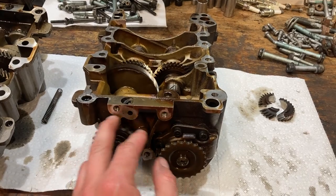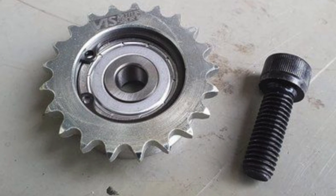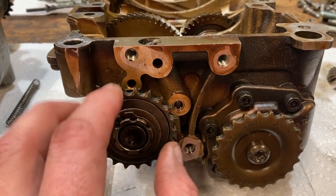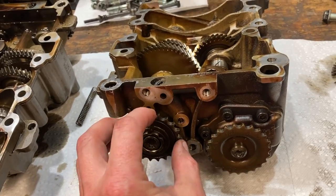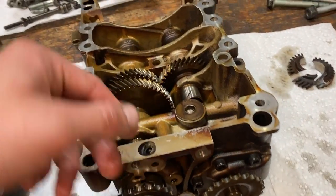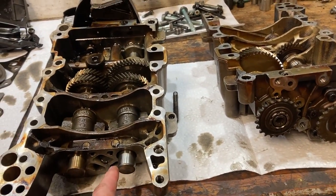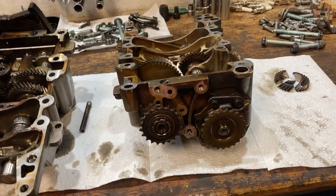Your second option is a freewheel option. What Wassa offers is a freewheel sprocket — you leave this whole pump assembly bolted to the underside of your engine and just swap out the sprocket. It disconnects the shaft from the sprocket right at that point, so as the chain comes around it continues to rotate the sprocket but the shaft remains inactive, making the rest of it inactive. That's about $187 to $250 and fairly easy to install. However, it doesn't work if you have my issue with oil pressure loss — I'd still have my oil pressure problem, so it's not an option for me, but maybe for you.